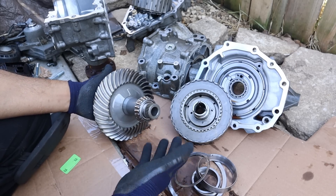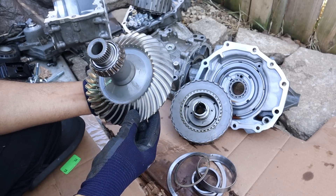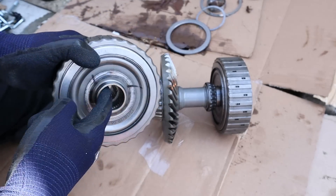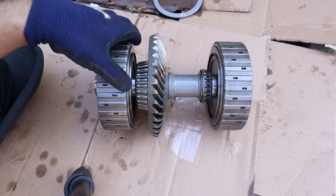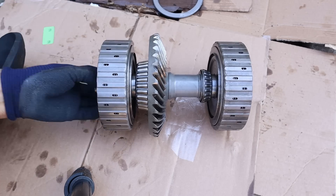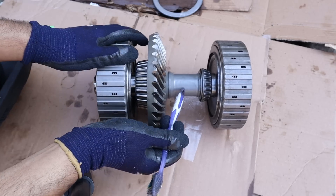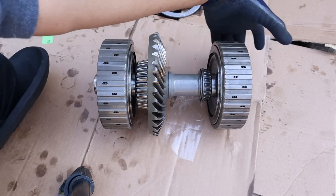Now we've got all the components removed from the rear differential of this super handling all-wheel drive vehicle. The pinion gear provides the input, which comes to this ring gear. It's going to spin this solid axle, which joins to the spline on either side, spinning the clutch pack. The clutch pack has an input from this spline — effectively splined to the ring gear — and then it's got the output which goes to the axle to power the wheel. Because the centerpiece is splined to some of the clutches, half of the clutches turn inside of here. The output is splined to the other half, and as long as this clutch is not applied or pressurized, this wheel can free-spin relative to the input shaft. That's also the reason why you don't have a spider gear setup — the car can negotiate a turn because you've got that relative slip between the left side wheel and the right side wheel.